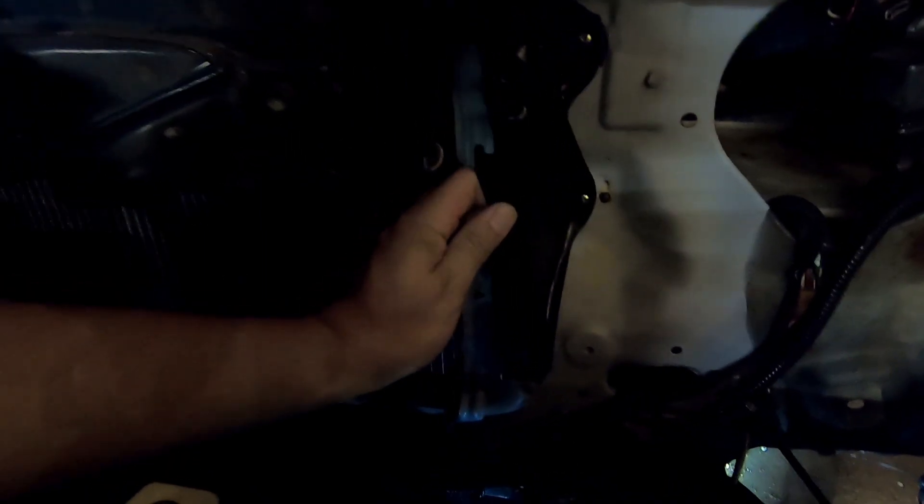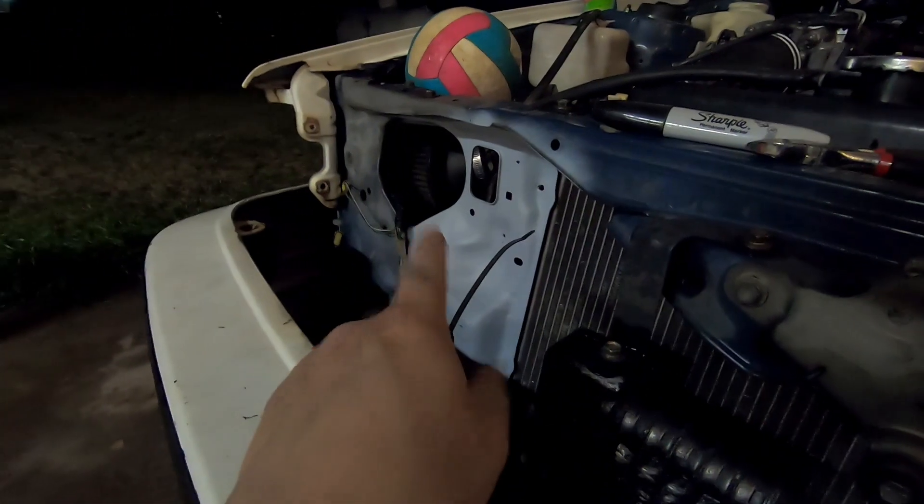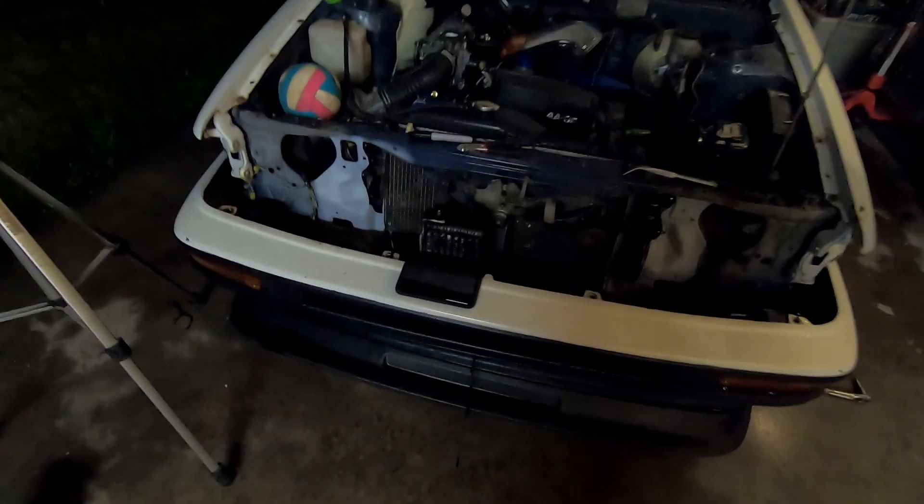I'm off again — I don't know how I did that even though I marked it, but it's off just by a little bit. It's okay, we can weld it shut later. I'm going to have to take these off anyway to redo this whole panel, paint it, and then re-rivet them back on. I need to drill this hole again and I think I need one at the bottom too. This car has a lot of drilled holes I need to weld up now because of my own mistakes, but let me go ahead and do this side and see if it works out.